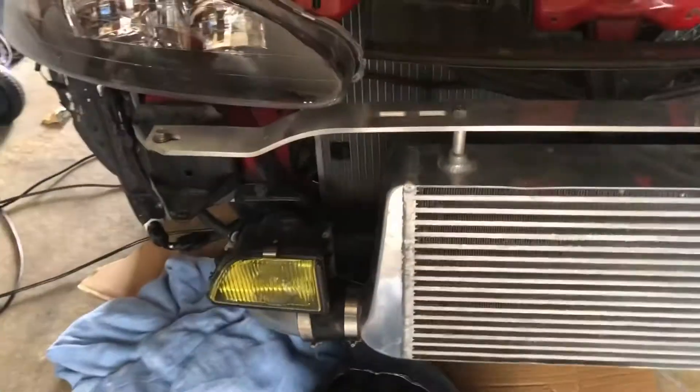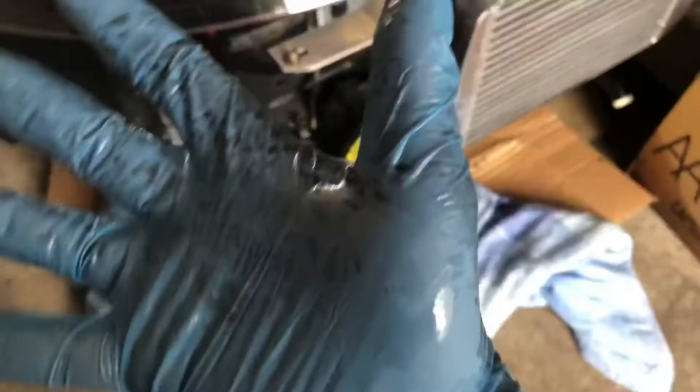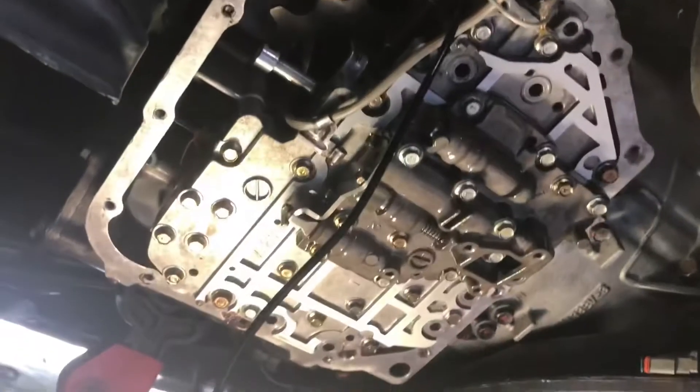It's dirty, I've got gloves on, so I really won't get a lot of camera footage, but I'll stop and take a break and film a couple things on the way. So I put the valve body back on with only two bolts right now. I had to slide the sensor up and through for the transmission solenoids — it's hard to get a good view of it, but it comes up right there where my finger's pointing. Slide that through and then we'll connect it at the end.